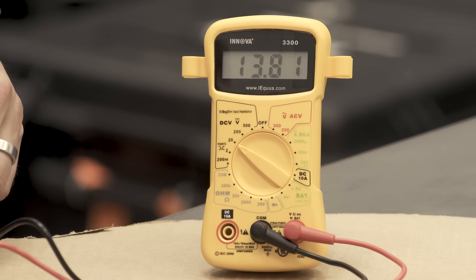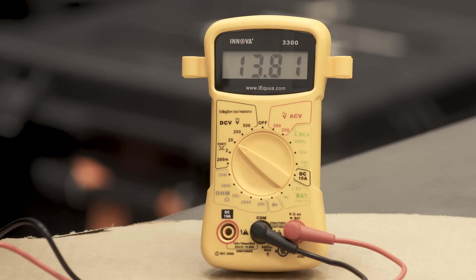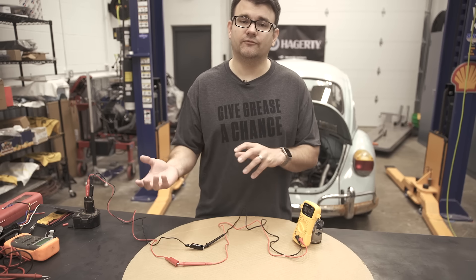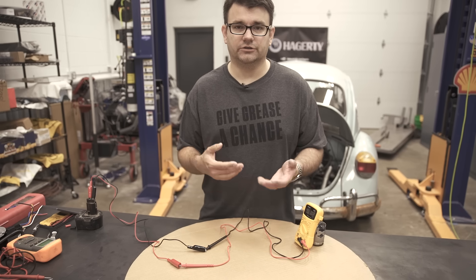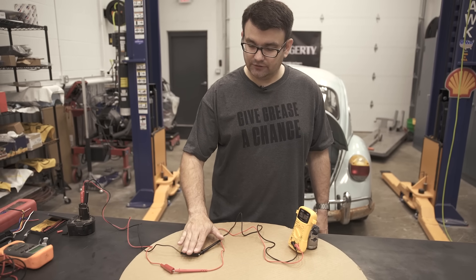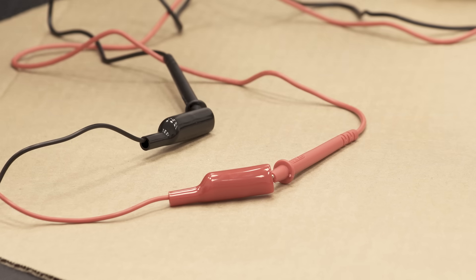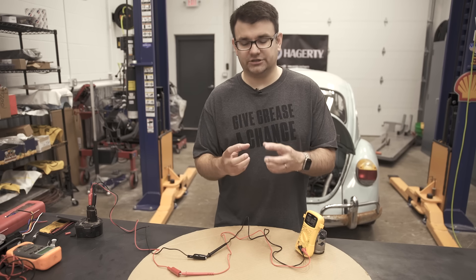It's pretty normal for a 12-volt system to actually read higher than 12 volts. A regular car battery is going to be between 12 and 13 volts if it's functioning properly with the car off. When the car is running, your charging system kicks in and you might see anywhere from 14 to 15 volts depending on what your alternator or generator is currently doing. When we're talking about voltage, we're looking at the electrical charge difference between the negative and positive terminals of a battery or circuit — a good analogy is like water pressure in your home.